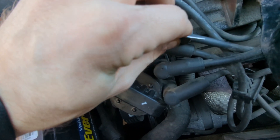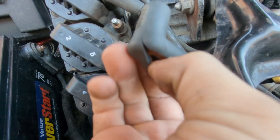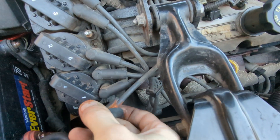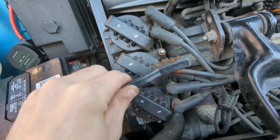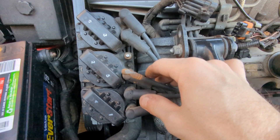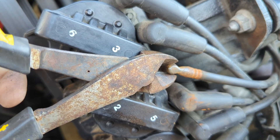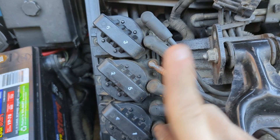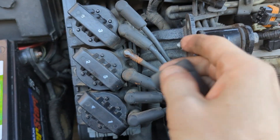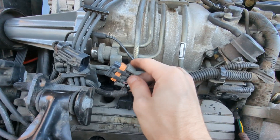We come over here, take the razor blade, and just cut the little boot off — real nice and gently. Look at all of that rust. Yeah, that's not good. That is incredible, honestly. I am legitimately surprised my engine was able to run at all. But we can definitely use a toothbrush on this now. Now we will put this back on and crimp it with wire cutters — we just got to make sure it gets a good connection. Funny thing, I was about to just leave it like this, but these are really high voltages and I don't want the voltage jumping to other things, so I'm going to put the boot back on even though it's cut. Now that this is back on and moderately safe, I just need to reconnect all of the electrical things I disconnected.